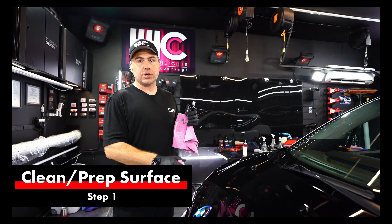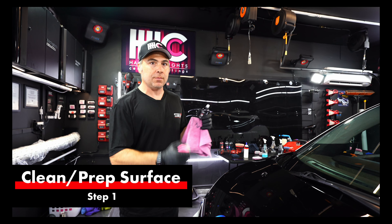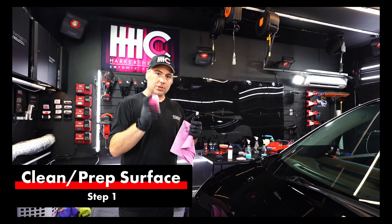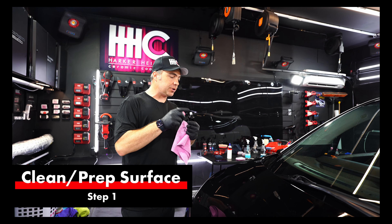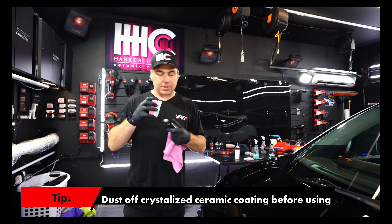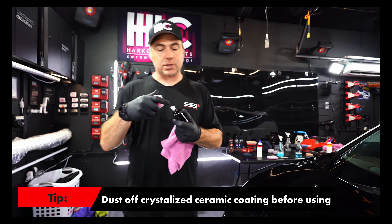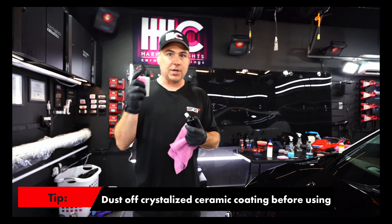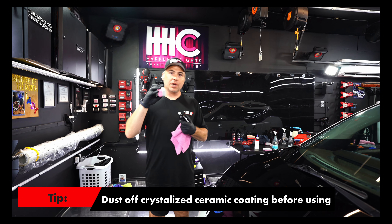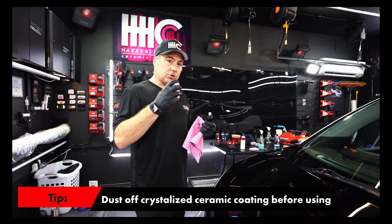You don't have to do a paint correction every time, but you do need to do a panel wipe. SB3 Ready is your choice there. Just like other coatings like Vortex, if it's not a new bottle, I use one side of the coating applicator just to dust off the top. This is a pretty new bottle so it doesn't have the crystallized stuff formed. Eventually that stuff builds up, so I use this to clean that off from the last application, and then I flip it over and use the other side so it doesn't get the crystal scratching the paint.